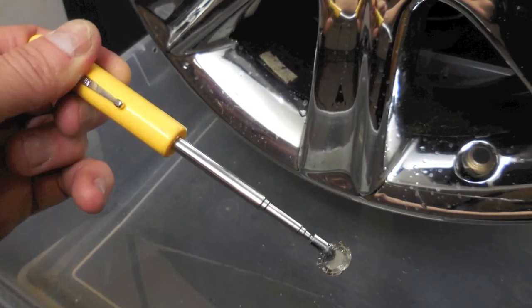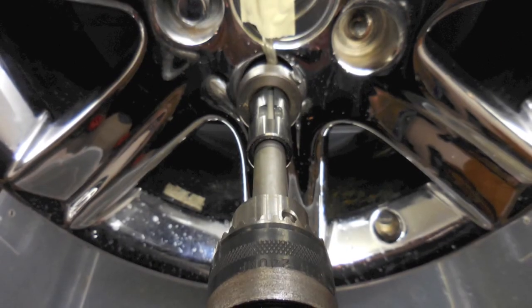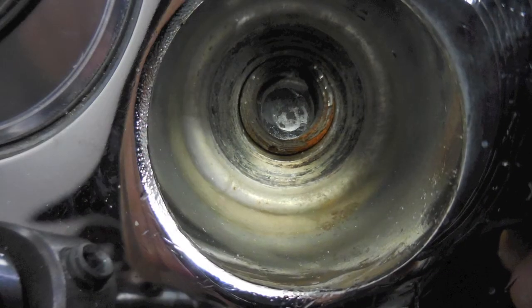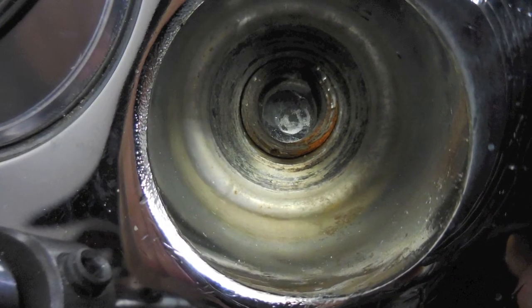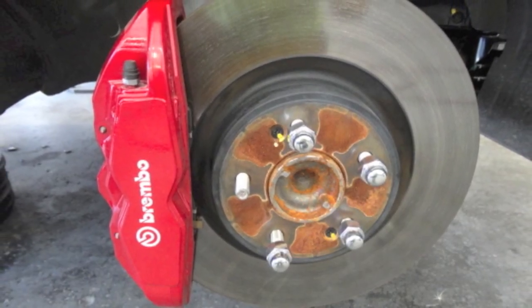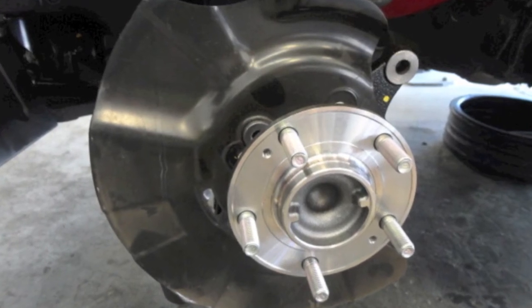You need to remove the head of the lug nut using a telescoping magnet — go right inside the guide to retrieve it so you can continue drilling onward. Once you continue drilling for about 11 minutes, the lug nut is completely removed. Here's a picture of the stud that's all that remains.